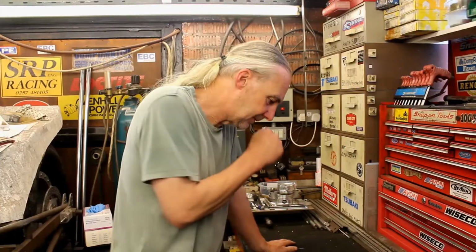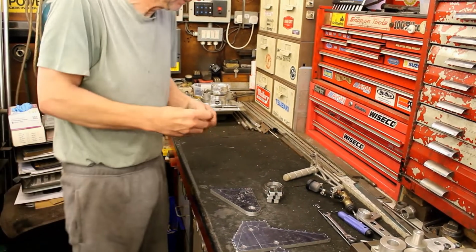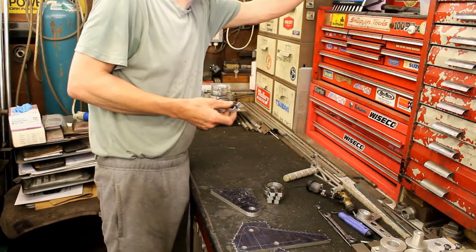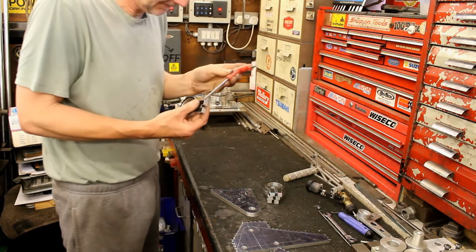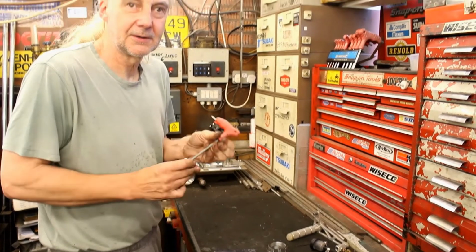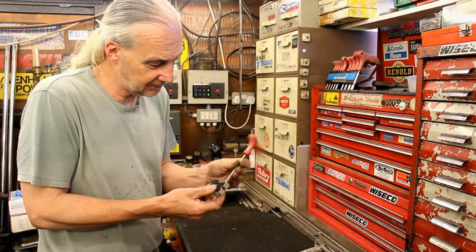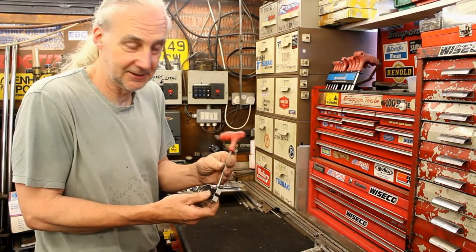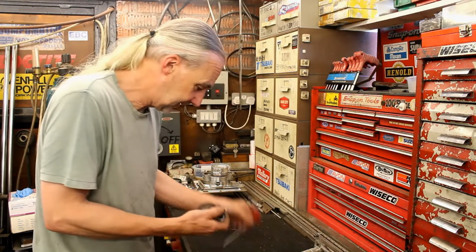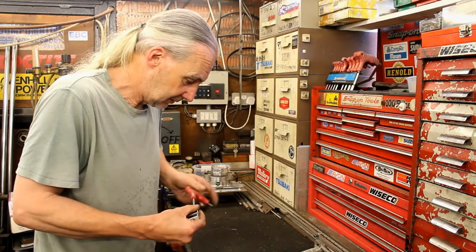So as I was saying, we've got something different there. We've got 4 clamps made to suit a 43mm set of forks off my Z. And you've also got those 2 brackets, which are going to be the headlamp brackets. What we'll do is, I'll just take 2 of them out. These took ages. I've used a quarter slit saw on its side in the Elliott to do these. The plate's 6mm. Like I say, they've got to be pretty strong, those plates, because they're also going to hold not only the headlamp but also the cockpit fairing.